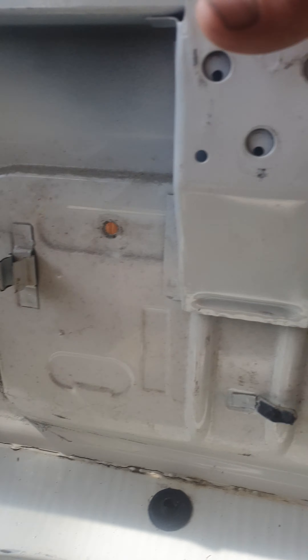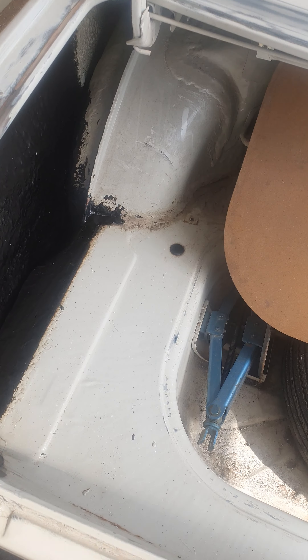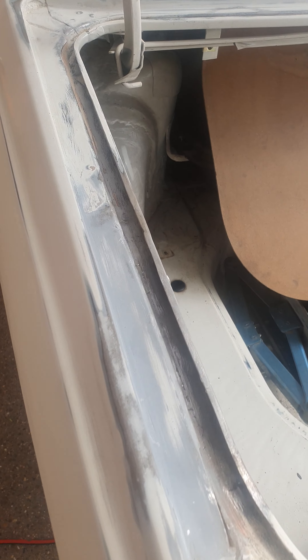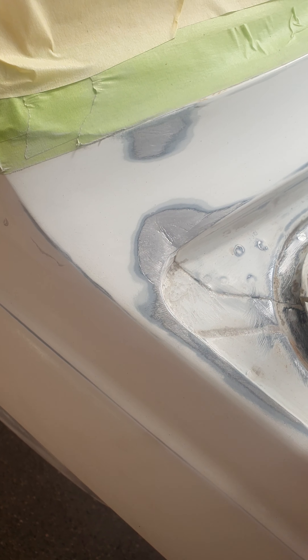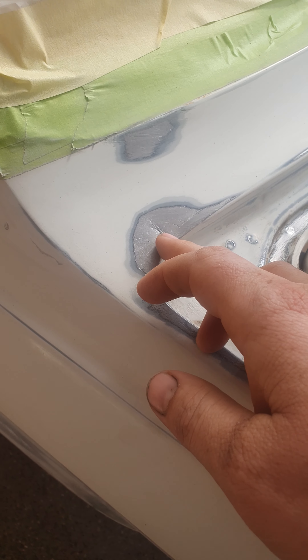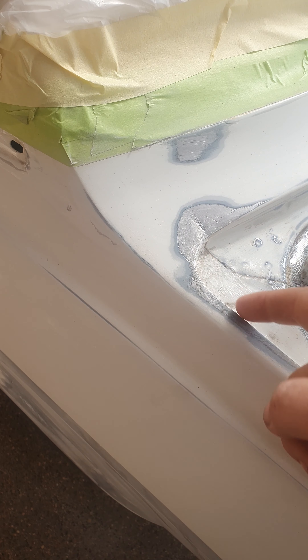There's a bit of straightening I did through the back here - just a little bit of heat to get some warping out of the panels. I'm going to be painting this section, that section, and this bit here. With Datsuns, rust is a huge factor, so I have to redo this section because all the way through here is brand new - the other piece had rust through the bottom. I'll get in here and etch prime all those properly. There's a bit of filler needed through here at the join in the two panels. Datsuns commonly twist and bend, and there was a slight variation - not a full crack but visible enough that I wasn't happy, so I'll fill that with some bog, etch prime, and paint it.